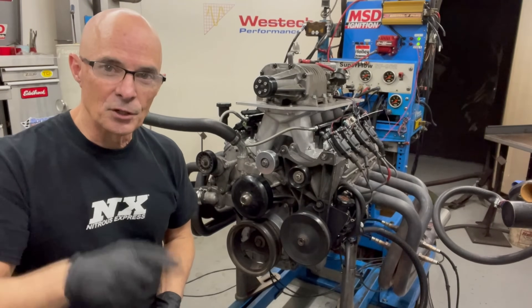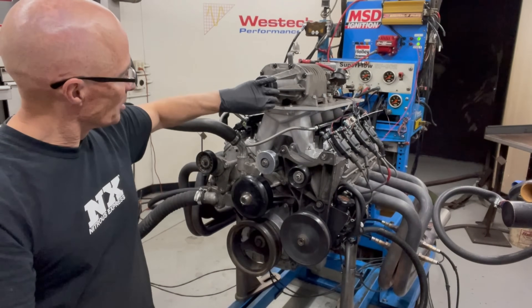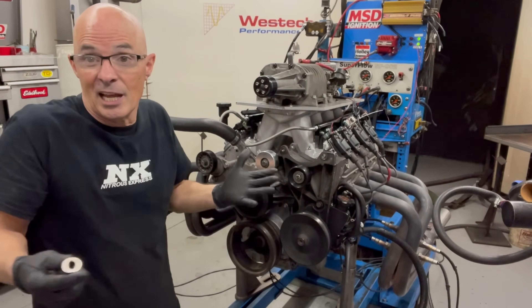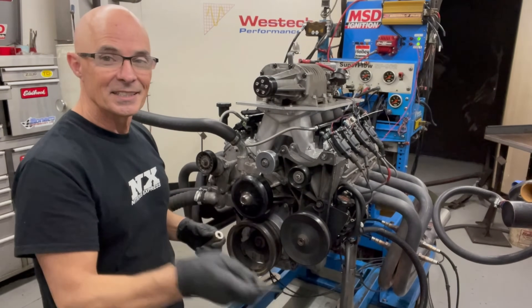The eagle-eyed viewers will notice I have an extra pulley here — actually it's an idler. What it does is add a little bit more belt wrap around this pulley. We didn't really have a belt slippage problem, but I added this pulley and it seems to help. Everything seems to be stabilized, but it's in the way, so I've got to take this all off to get to the accessories.